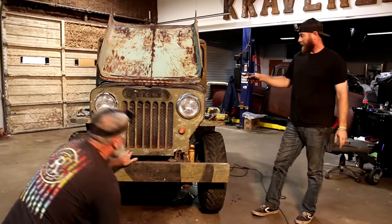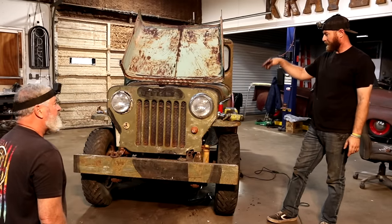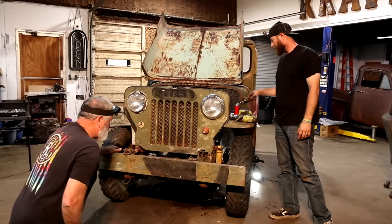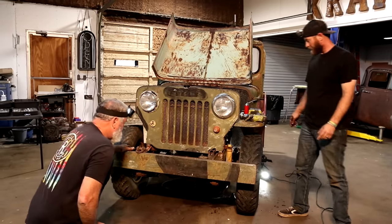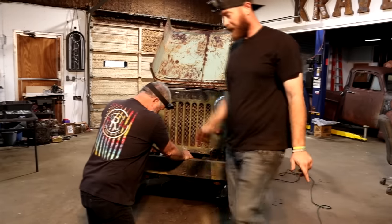I think we probably just go ahead and put some diesel in that block, let it set. Because if that vinegar breaks through, those cylinders is gonna mix with good oil anyway, so that crank wouldn't hurt to soak in something that'll clean it a little bit more. But hopefully it's just stuck in the pistons. Just a waiting game at this point.